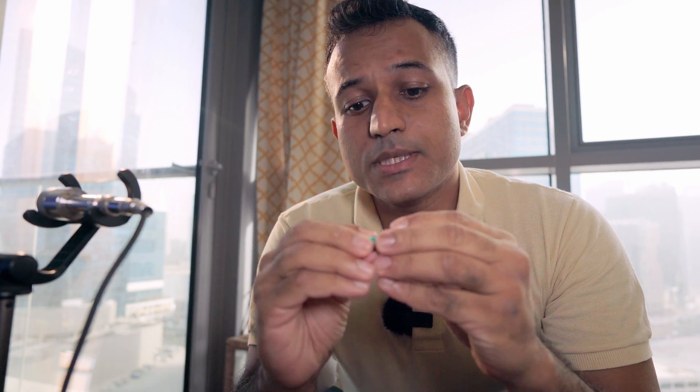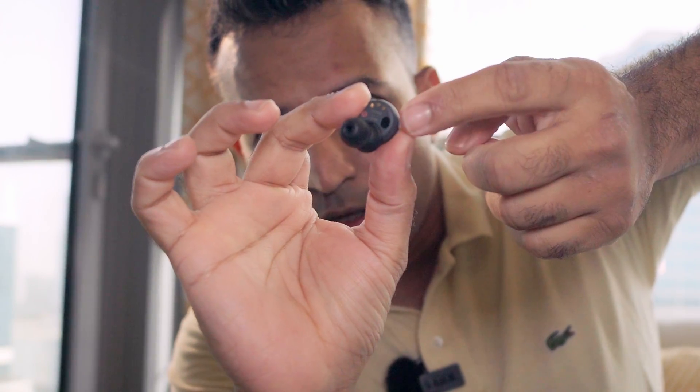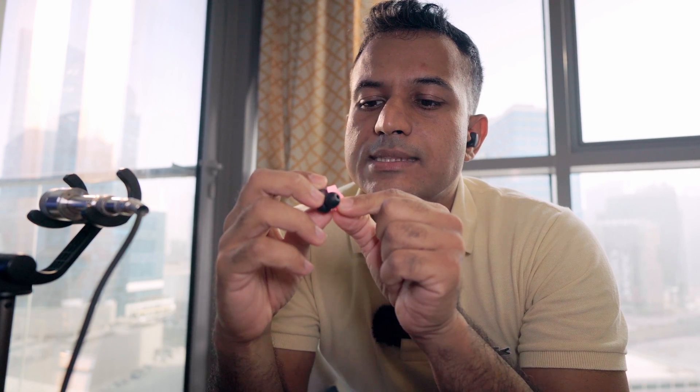A couple of quick things about the Bluetooth earbud. Number one, this is not the original foam tip, so I'm going to install the original Sony LinkBuds foam tip so no one can say we were cheating. Also, once we put this in the coupler, the problem is all of them now have in-ear detection, which means if they detect they're not in the ear, the ANC usually just turns off. That's okay though - there's a little photoelectric sensor that senses light and darkness, and if it senses darkness it assumes it's in your ear. I'm going to use a little bit of post-it and put it right over the sensor. I can hear through the other earbud that it's gone into ANC mode. Now we just put it here and we should be good to go.